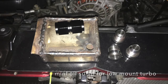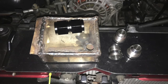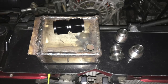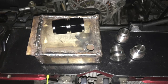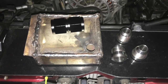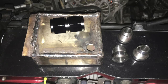Here we have a mini oil sump that I made for the low-mount turbo, so the oil drains from the low-mount and then gets sucked out of the mini sump with the scavenger pump. That way the oil can drain out of the turbo and doesn't get blown past the seals. Towards the end of the video I'll have a check valve install — this will make sure oil does not come back from the large engine sump into the low-mount mini sump and back up into the turbo.